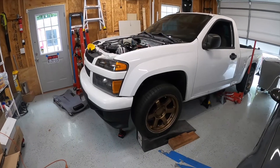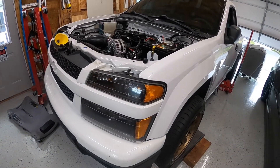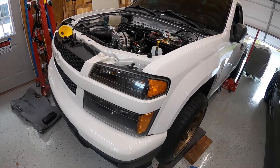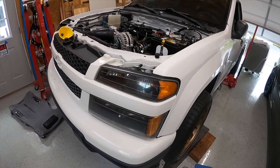Nothing on the first start - I'm getting absolutely nothing. I'm thinking either not enough power or potentially a bad ground, so I might add a jump pack and start there to see if that works.